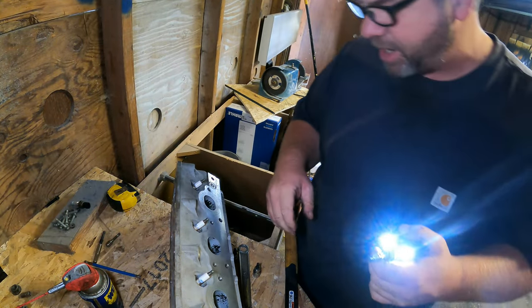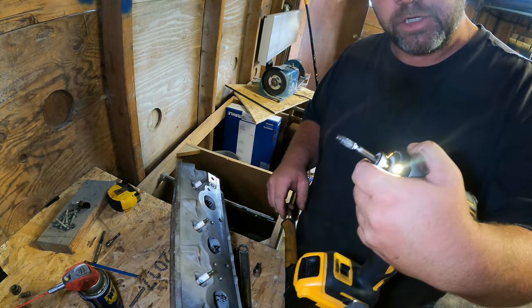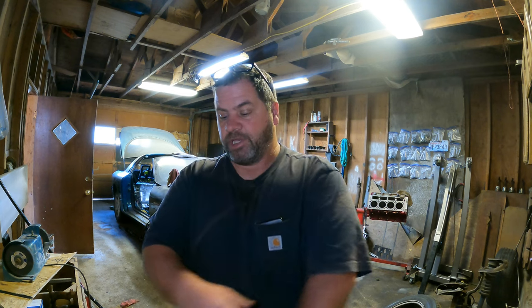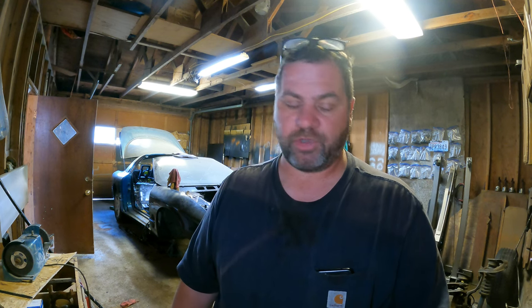Victory is mine. That's one. Well, I may have spoke too soon, or not really spoke too soon, but I was celebrating a little too soon. So I did get that one out, and I was working on the other one, and I thought heat helps. So as the easy out was in there, I put my impact on it, and then I heated it up with a torch, and the easy out kind of exploded.